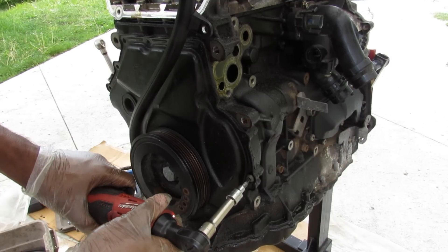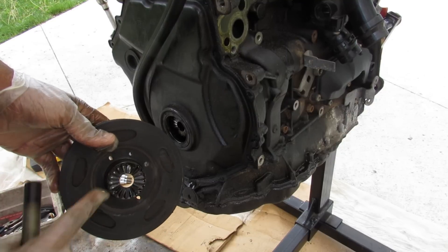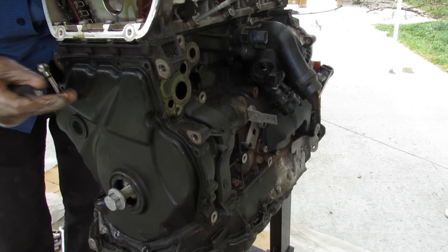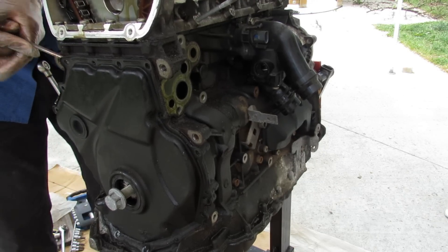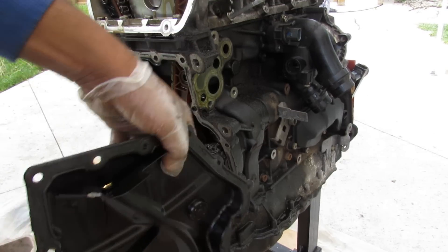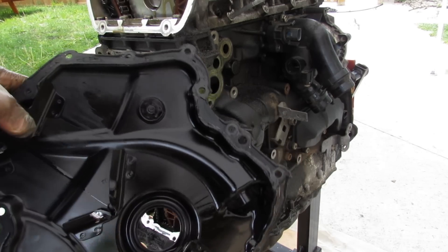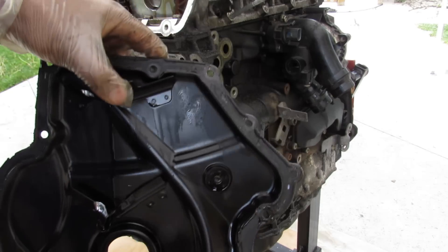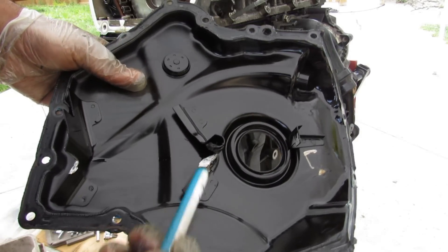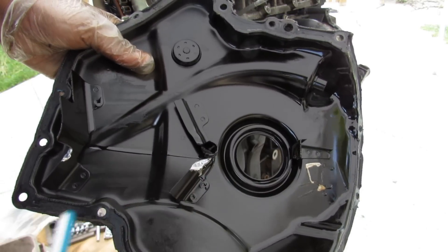Now I can access that hidden bolt. I'll pull off the crank pulley — they sell a special tool with teeth that you can use to properly turn the engine over. The thin stamped steel timing cover means you run the risk of bending it as you take it off, and as you can see I bent it over here. When replacing these, if you're not careful you'll likely just have to get a new one, because it's soaked in oil and will cause a leak if reused. I've also noticed damage inside — looks like the chain or one of the tensioners was grazing against it when it was rattling.